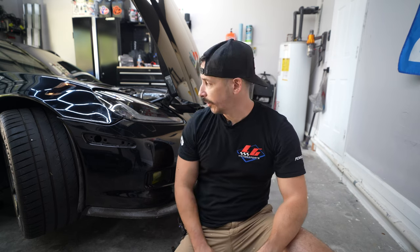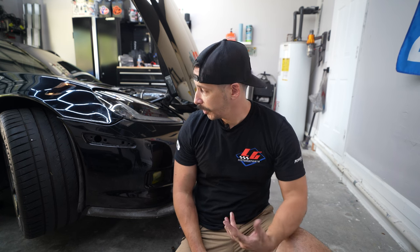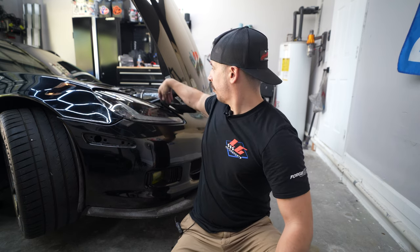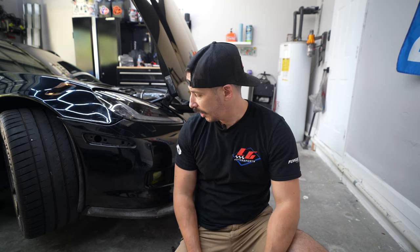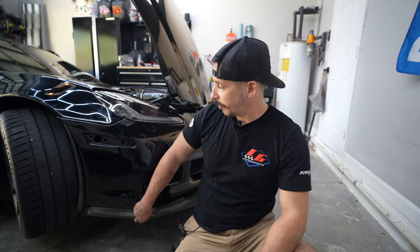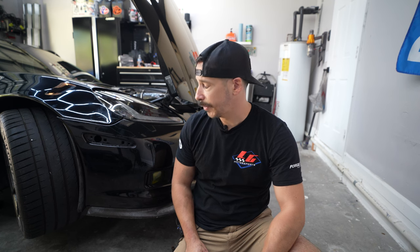What I admire about this old Corvette is its over-engineering. A typical car bumper has a couple screws on the fender liner and a couple on top, but this thing has screws everywhere. I've unbolted from the top, taken the fender liner off, and all the top bolts are loose. This car has a ZR1 lip with ZR1 brake ducts so I have to loosen that too. Then I need to disconnect the wiring for fog lights and side markers. The bumper has most screws out but is still very stiff.